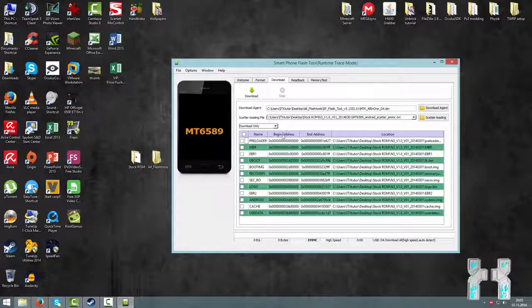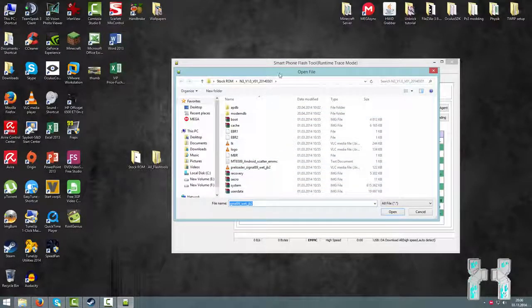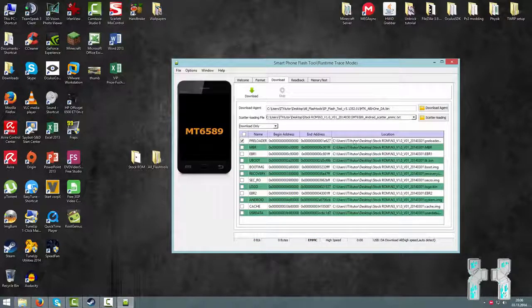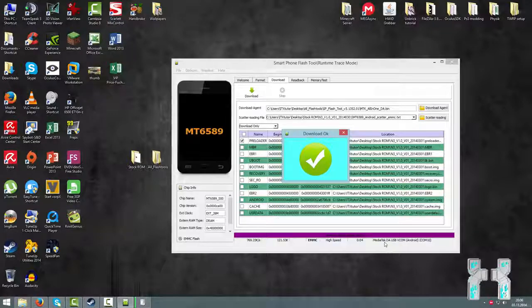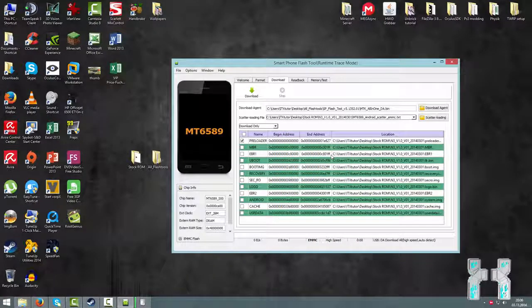First we'll try to download the ROM. For example, if I've flashed a wrong ROM including the preloader, the preloader may be broken. Check the preloader, point to it in your stock ROM folder, then hit the Download button. Connect the smartphone like before to get META mode — keep pressing volume down and connect the smartphone. It should be detected, then disconnect, and the preloader gets flashed. Once done, the preloader should be back working. You can verify by reconnecting — the preloader should appear in the Device Manager.